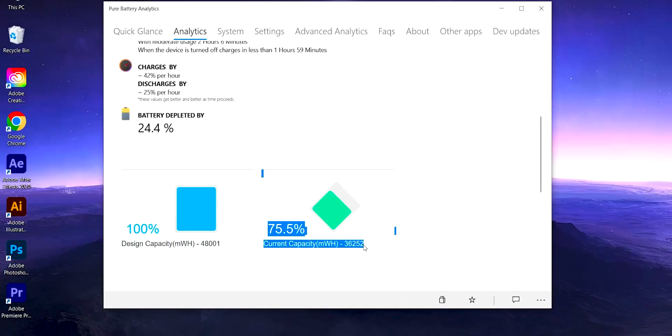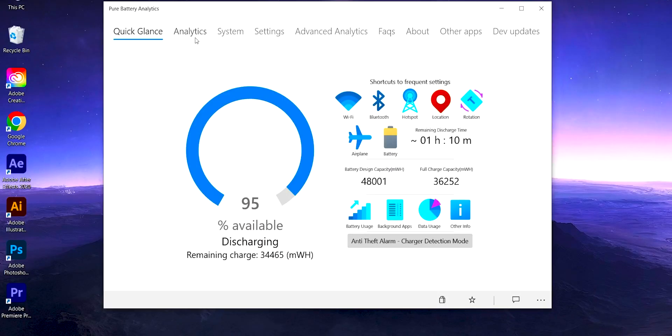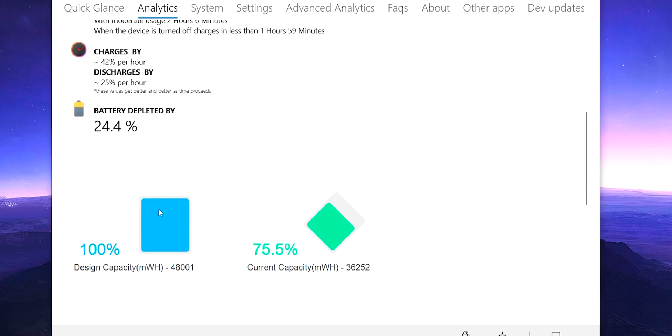Next, check the wear level of your laptop's battery. The wear level is the current chargeable capacity compared to the total battery capacity. Use battery analyzer applications, but make sure the laptop is calibrated first for accurate measurement. For a new laptop, the battery wear level must be around 0–3%. If it's above that, the battery may not be calibrated properly, or it could be defective or already used. After a year, wear level can reach up to 20%, meaning you can only charge to 80% of capacity — but there are ways to prevent this wear level issue.